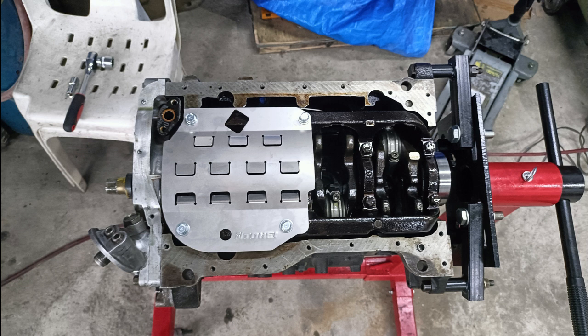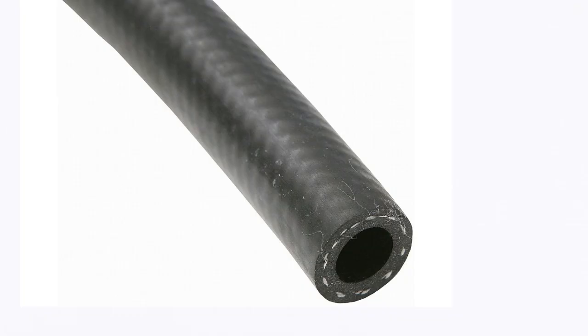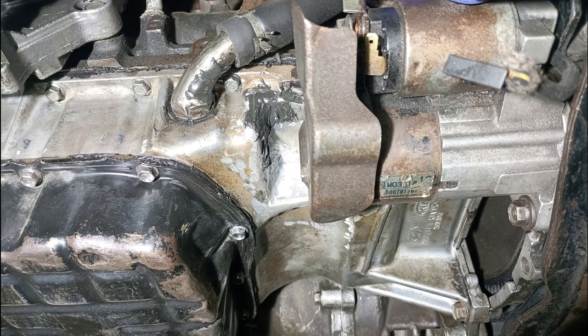Since this is more of a conversion adapting the EVO turbo to the Hyundai block, the oil pan does not have an oil drain, so we used an EPDM rubber material for the oil drain line. While it's not really an upgrade, it's a maintenance item we have to monitor every time we put the car on the lift. EPDM is a very heat-resistant material used in all sorts of OEM components in the engine bay, so we know it is a good material — but we have to monitor it from time to time to ensure there are no leaks from the turbo oil drain line.